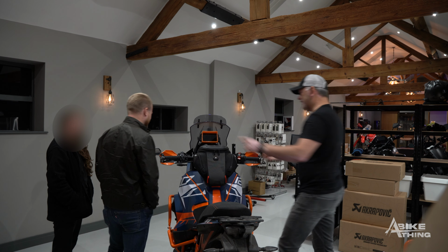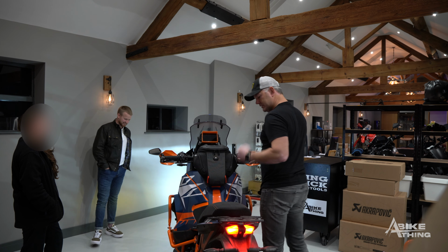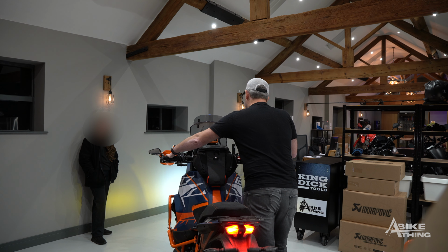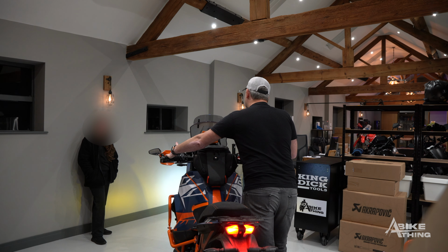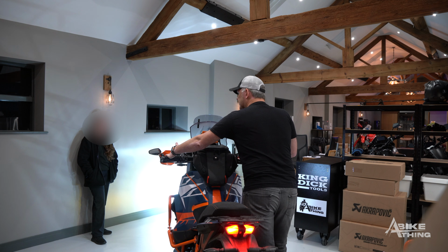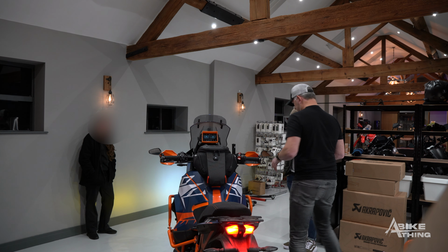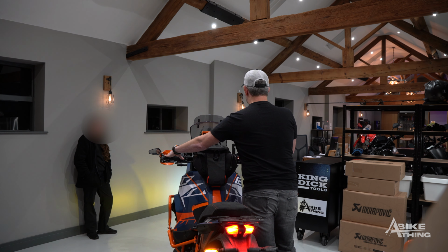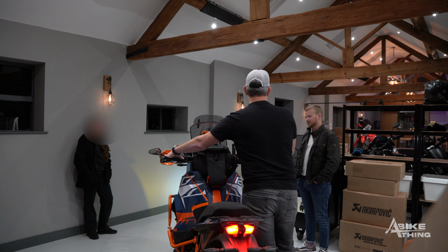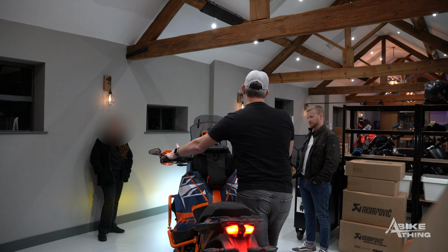Right, so let's power it on and I can show you it all working. Remember myself how to turn these on now. The key's there. The D7's on right now, okay. So if I do that, your D7's come on as well. The S4's go from 30 to 100. So when we indicate, you'll see I've got the S4 going off. Yeah, perfect. I like how it comes on slowly. That's nice. That's all part of the PWM, what Denali called Data Dim 2.0. I like that. 1, 2, 3, and then you get your strobe.